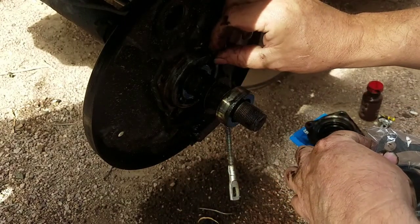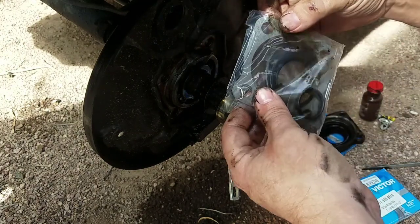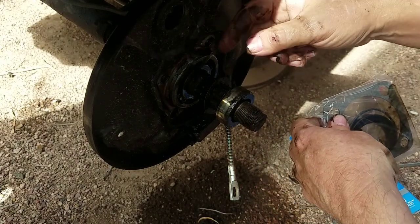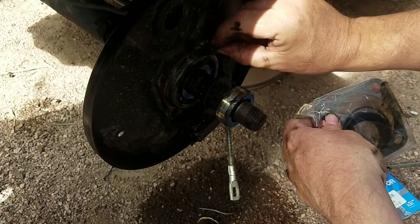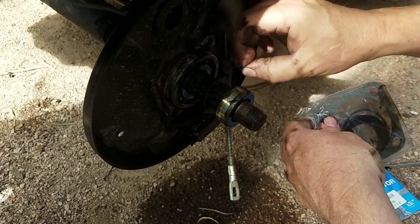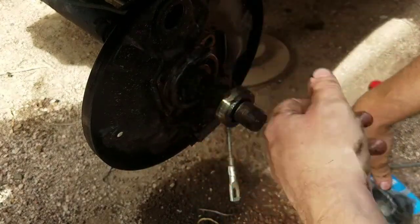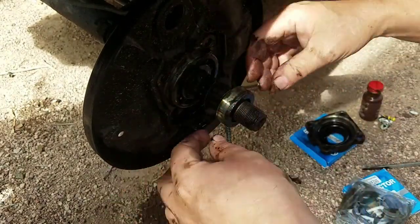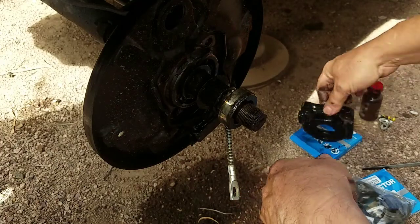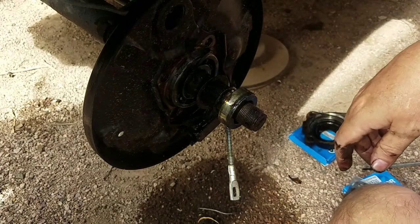The old thin yellow paper gaskets — the factory setting was to put two in. This one only has one, which is a little weird. It's hard to tell because it's so deteriorated. Obviously this is where my problem is because everything in here is in such poor shape. I'm going over the parts order so you can see it, then I'm going to throw it all in carb cleaner.